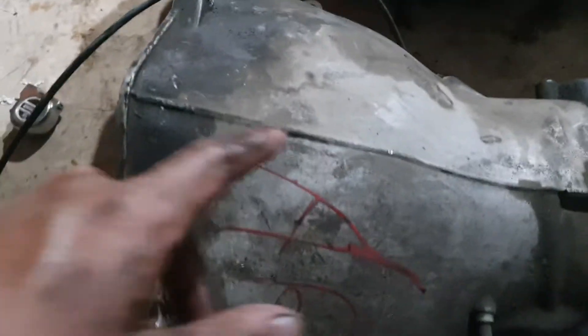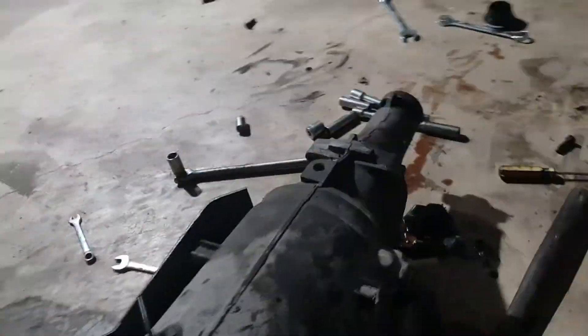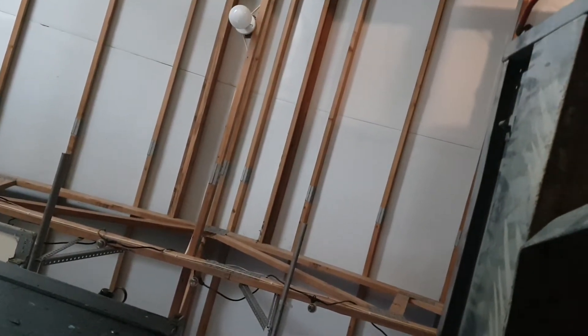You can see RTV right here at the edges, and there's a big piece right there — somebody resealed it. The pan looks the same way. There's a marking here, probably from a junkyard. Also, the torque converter does not look stock; it looks like a newer or maybe upgraded torque converter. I'm going to pull it out real quick to show you the coolest thing that indicates work has been done to this.